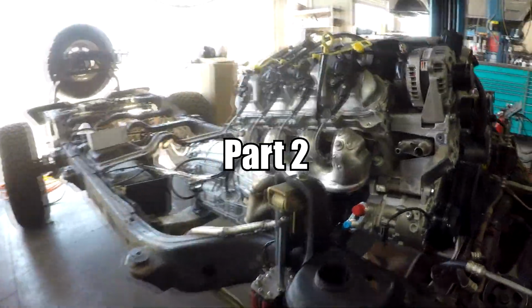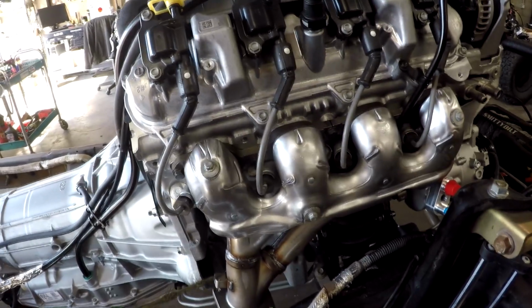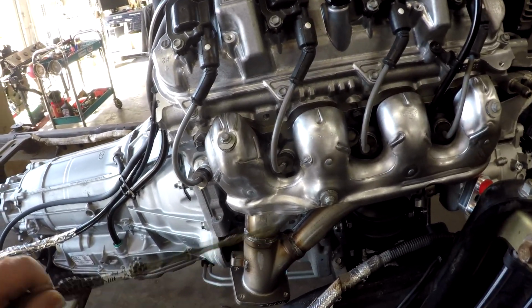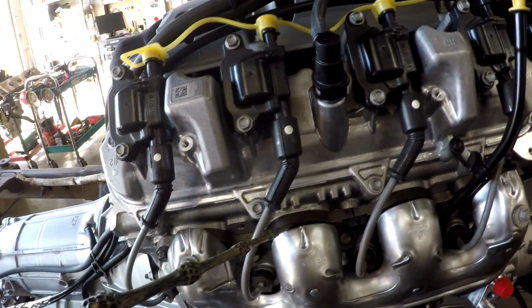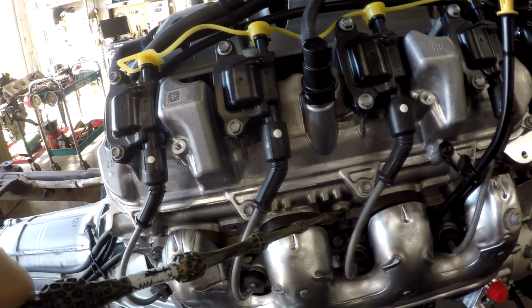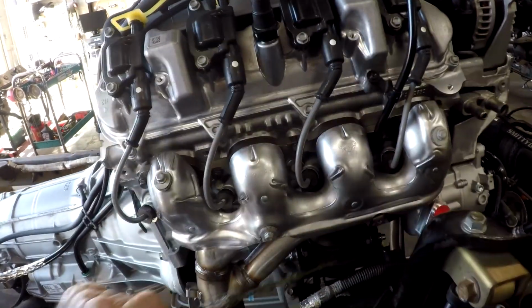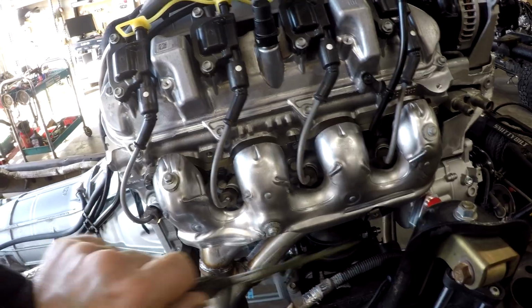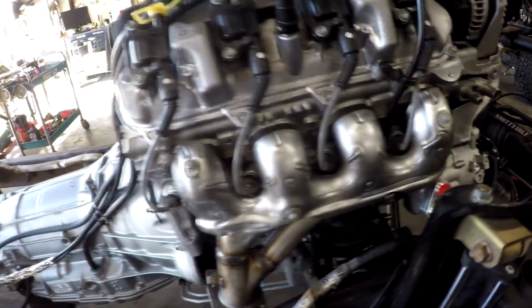So walking around the side of this, you can see again we have our really nice stainless steel GM Performance shorty headers. Look how thick those flanges are. That looks like at least ½ inch to me, and they are cut for stress relief. We are running a full-size hydraulic. That's a liquid-filled engine mount. These are our bolt-in easy mounts, so there's no fabrication.